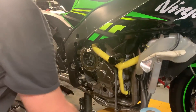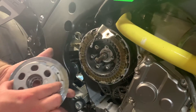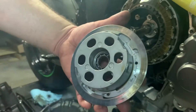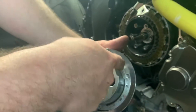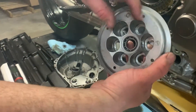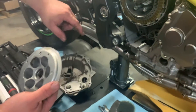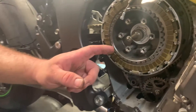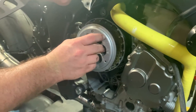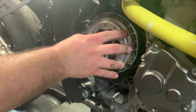Next we're going to get your pull rod that goes in there. The outer basket has three indentions — one in the middle and it's got a little divot right here, marked by two little indentions. Those go right here — there's one here and one there. It's the only way this will fit. I get a lot of messages asking how to put this on. Make sure it's nice and flush and free.